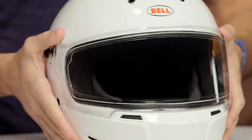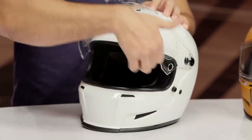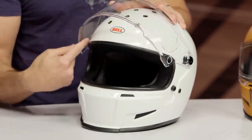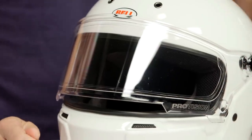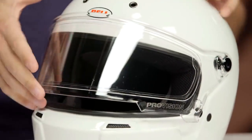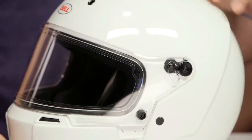The other really cool thing about this helmet is Bell's own anti-fog system. We've seen Arai come out with their SAI MaxVision a few years ago, which takes the Pinlock approach and maximizes it. Bell has now developed their own, called ProVision. It's a double-paned window system that uses physics — a second layer of optically correct plastic that traps a layer of air, so you don't get fog or condensation. It's not chemical, nothing's going to wear off. It's non-removable and fully integrated, so very low maintenance moving forward.